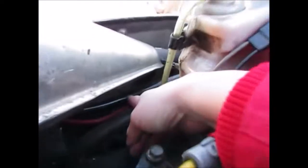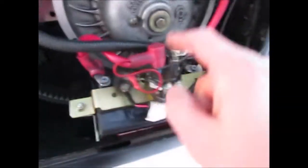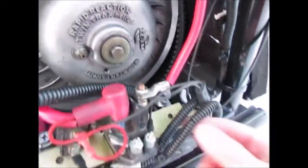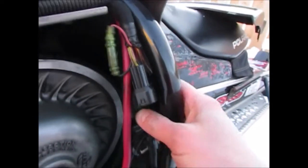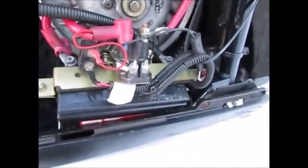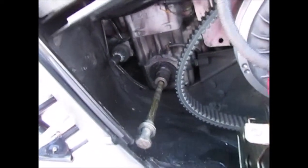For the wiring, the positive cable goes on the side and is secured with tie wraps — I ran it around the airbox and back out. This wire is about six feet long and runs to the solenoid. The battery hooks up to the solenoid, the negative goes to a ground point, and the solenoid connects to the wiring harness already on the sled. I also used a tie wrap to hold the solenoid to the battery.